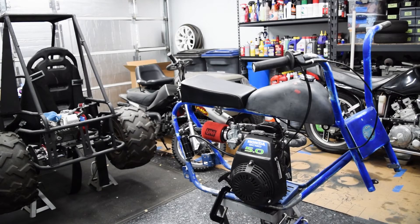This project has come to a screeching halt specifically because my welder has died. When everything requires welding, I can't really do anything without it. What's happened, I think, is that either the transformer or inverter is failing because sometimes it welds okay, but other times it looks like garbage and you can just pull the welds off with pliers. I've welded the footrests on four times and can knock the tabs off with a hammer very lightly. The front gas tank tabs also need to be welded, so that can't be done either. I also axed the chain guard — one, because it wasn't going the direction I liked and was getting uglier, and also because I can't weld it. I figured I'd just buy a nicer one since they do make them and they're pretty easy to get.